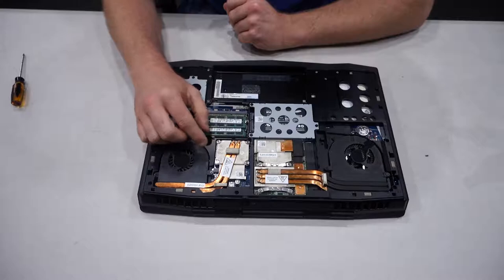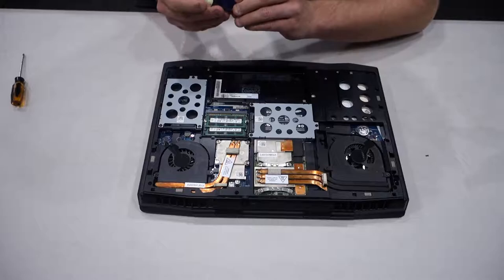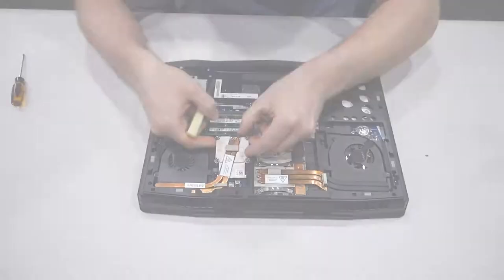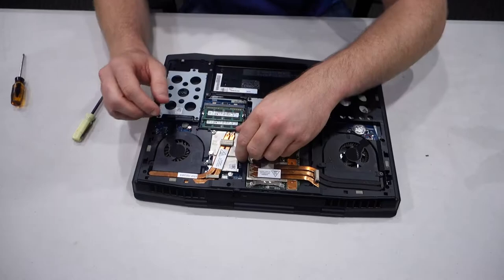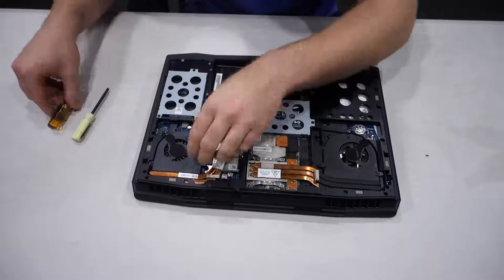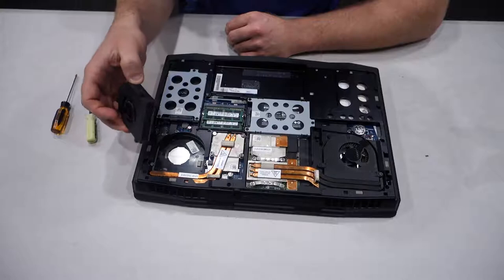You can see here we've got four screws, one on each corner of the CPU block. So we're going to take out those four screws and have a look underneath. Now that should just be able to slip off. It's a bit difficult — I believe I may have to move the fan here as well, one of the back fans, to actually move the heat pipes out of the way so we can have a look at the CPU. Here is one of the fans we've just taken out. I'll probably need to clean the dust out of this anyway — that could be part of the problem of this laptop overheating.